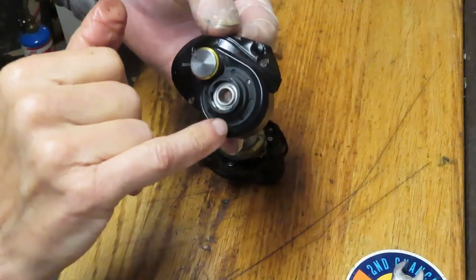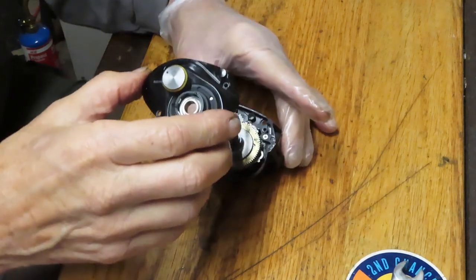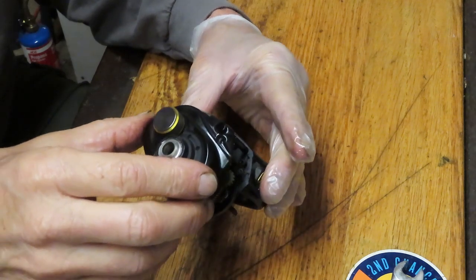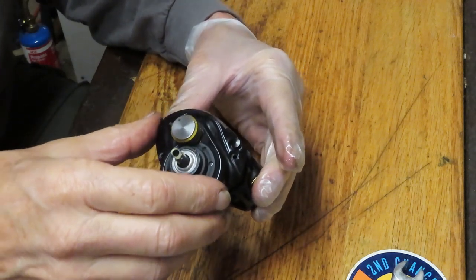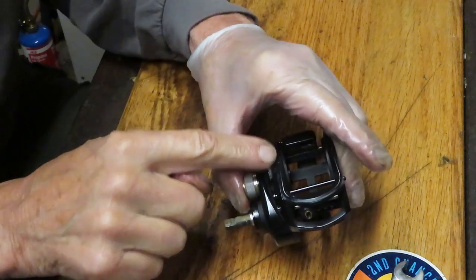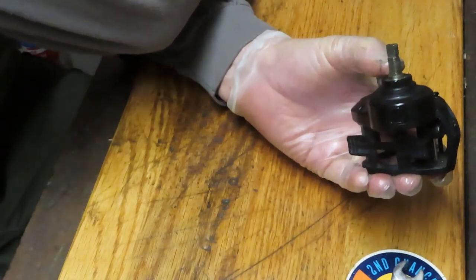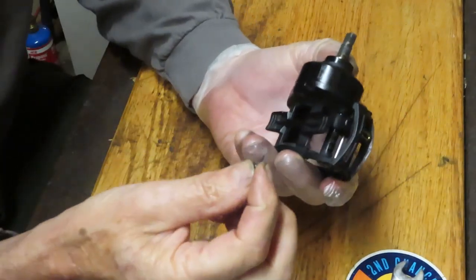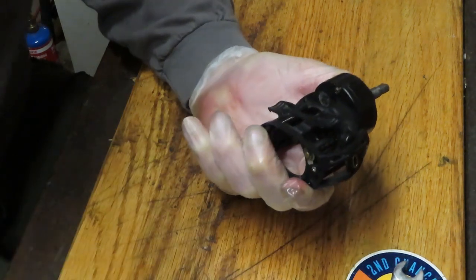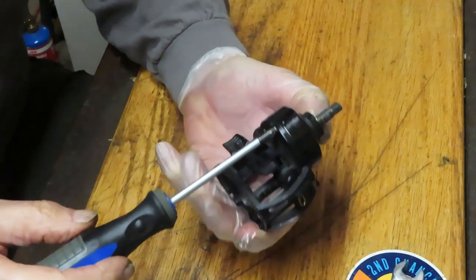Our case also has another spacer bearing on that, our sleeve on that bearing. And to install the case, find the hole for that override, or the case release if you will. Bring the whole assembly in and align them, making sure that you have a nice, even seam for that. All right, kind of crazy that there are 4 different screws here. The first one is a rough thread, and that's going to go into that little opening there.